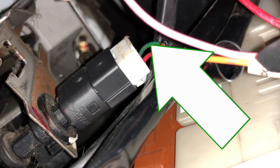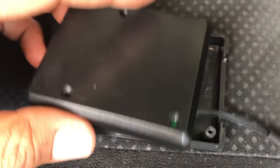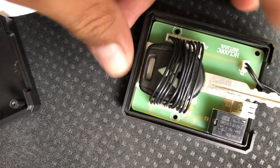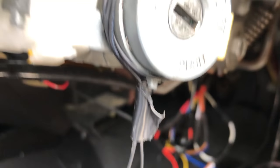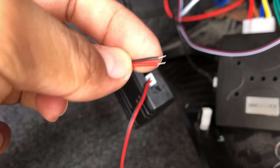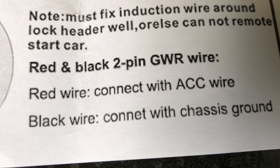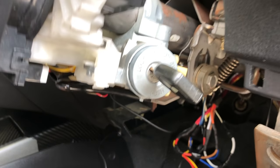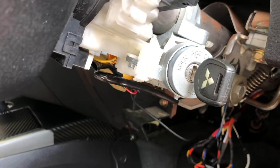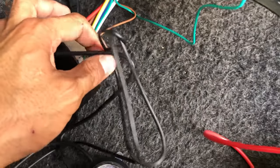Let's connect the green wire to the foot brake signal wire. Once connected, put electrical tape on that connection as well. For cars with a chip in the key, you will need to purchase an immobilizer bypass module. You will also need to have a duplicate key made. Take your original key and place it in the immobilizer bypass module black box below the induction coils. Close up the box, then take the black loop and wrap it around the ignition lock cylinder about 3 or 4 times and secure it with electrical tape or a zip tie. Connect the red wire from the 2-pin connector to your accessory wire, and the black wire to a grounded part of your car. Take your duplicate key, turn the ignition switch to the accessory position, cut off the head of the key, and cover the ignition switch with something like a black piece of cardboard. Once done, everything else is just plug and play — plug in everything and reconnect the negative car battery lead.